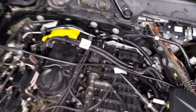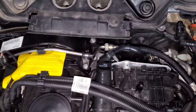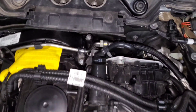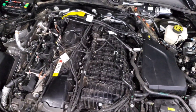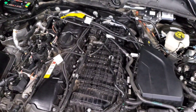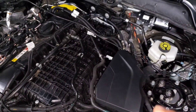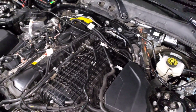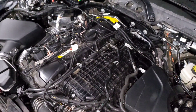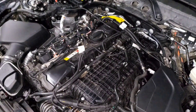In the future, if I ever want to, I can splice into that section and add a T-fitting, then run it out to a fuel rail and set it up for port injection — so it seemed really convenient. All I had to do was replace one of those male adapters with a female one and replace that line. This is a good example of why you want to map out your connections first, because it can save you a lot of time.